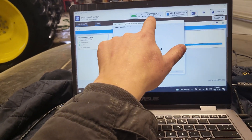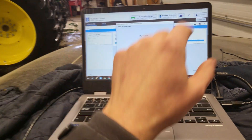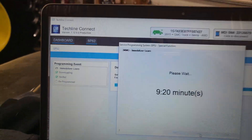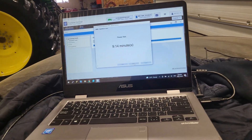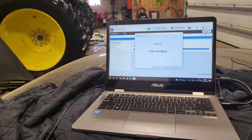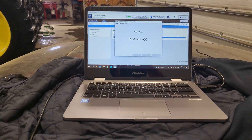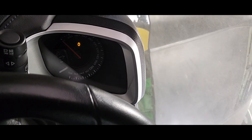I ended up having to reprogram the original VIN number into the ECM — the VIN from the truck the ECM came out of. I licensed that VIN, went back into SPS, and went through the immobilizer relearn. I ran the state of health check, which takes about 11 minutes, and it came back successful. After that I tried cranking the key and the factory immobilizer system is working exactly as it should.